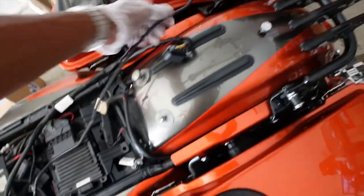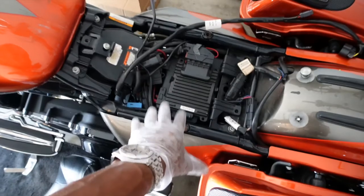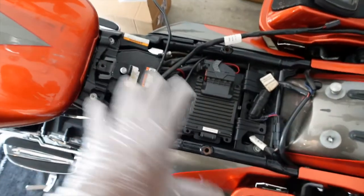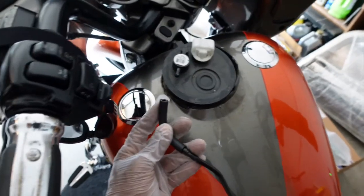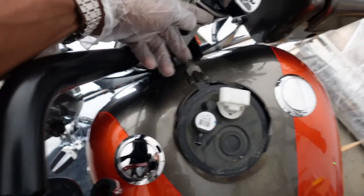All right, a few moments later — I couldn't find a good spot to put my camera down so I went ahead and got started. I'm gonna walk y'all through the process of what I did. Of course, you gotta remove the seat. Now on mine, my plugs are here. On some Road Glides your connection is going to be here to where you disconnect the fuel line from the bike. On CVOs it's going to be there. When I took my seat off there was a bolt down here which is a 10-millimeter, and there's a bolt at the top that you gotta take off.